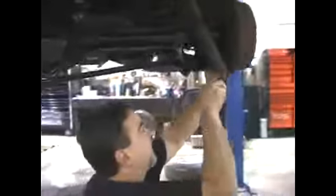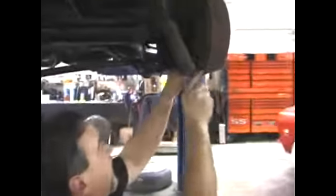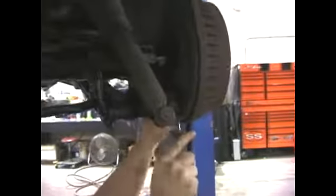Since tapping gently with the steel dead blow hammer didn't work, Mark's going to remove the little protective window insert for the brake adjustment. They're automatic adjusting brakes, but they still have a window in them so you can adjust them and back them off. Mark is thinking that there's enough wear in these drums so that the brake shoes will be touching it hard enough to keep the drums from coming off.